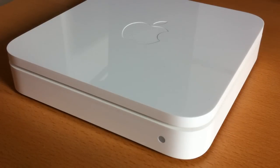I've never actually owned another wireless router that claims to go 450Mbps over the 5GHz band. The simultaneous dual band is also a very useful feature, providing the AirPort Extreme with a combined figure of 750Mbps over Wi-Fi, considering the 2.4GHz and 5GHz bands can both be running at full speed simultaneously — though a single device cannot be connected to both bands at the same time.